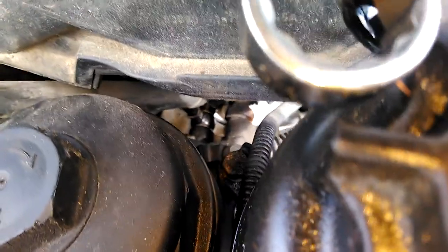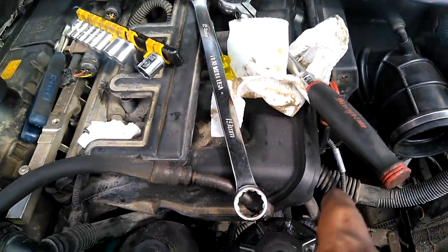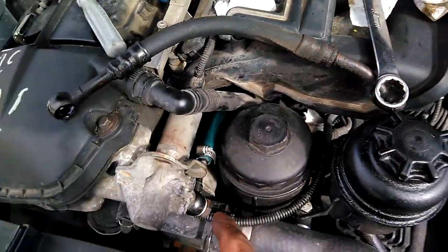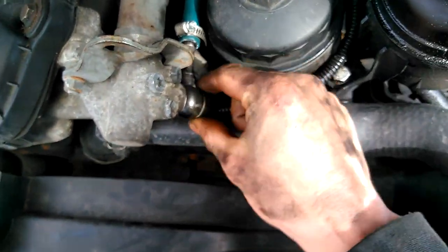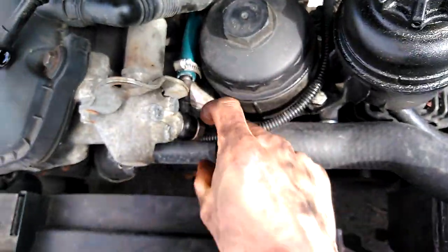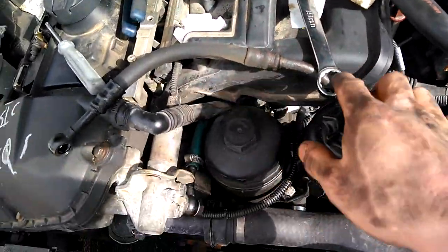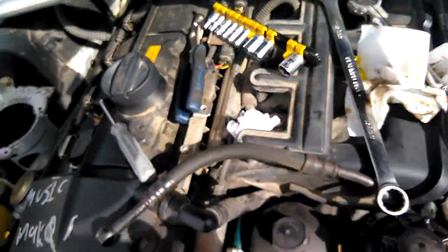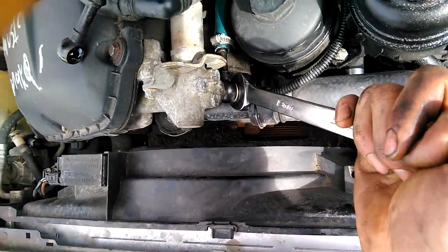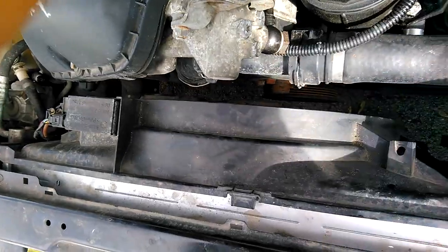You can see the bottom one is right there, nice and tight. Having quality tools helps, but the old-fashioned wrench did the job better in the end. Finger tight always does a lot of work in those tight-to-reach places when you can't get a straight line. Just enough with these guys, then you flip it over and get those two sides. Remember that these banjo bolts are steel and the other components they're going into are aluminum, so you wanna be fairly gentle with that kind of stuff.